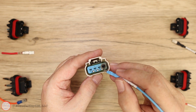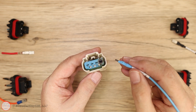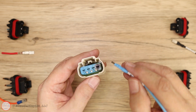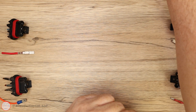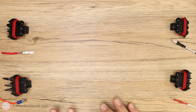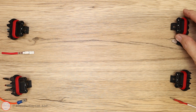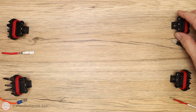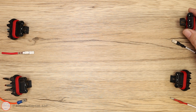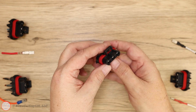That's a common failure point in the fuel pump connection on the Chevrolet Caprice and the Chevy SS Sedan, potentially when they get over about 100,000 miles. With the Chevrolet SSR, there is a similar connection failure point on the cooling fan. The cooling fan connection was designed to be connected and disconnected no more than 5 to 10 times, and it can be an issue given the high amp draw through the connector. I was sent examples of failed connectors from Mike at Simple Engineering.